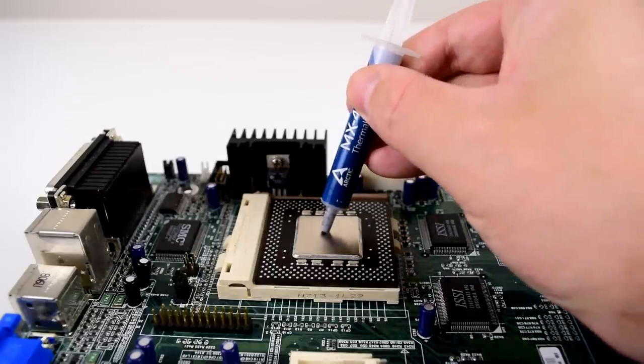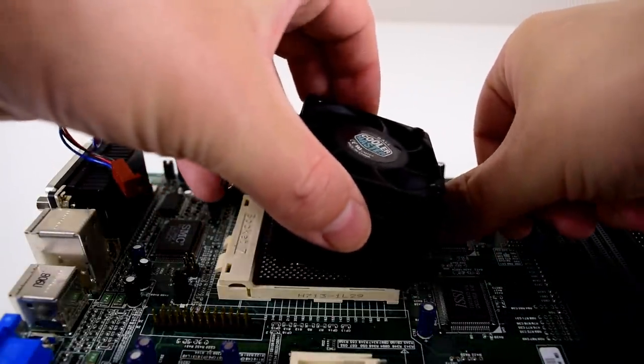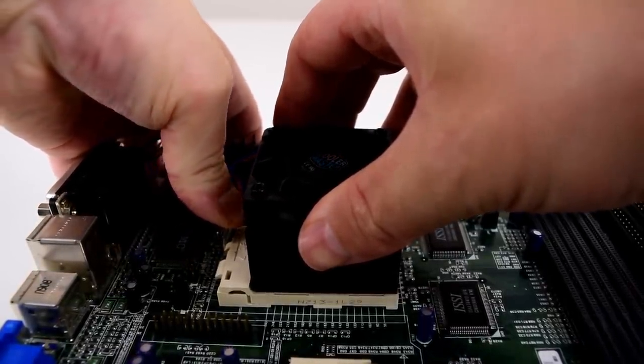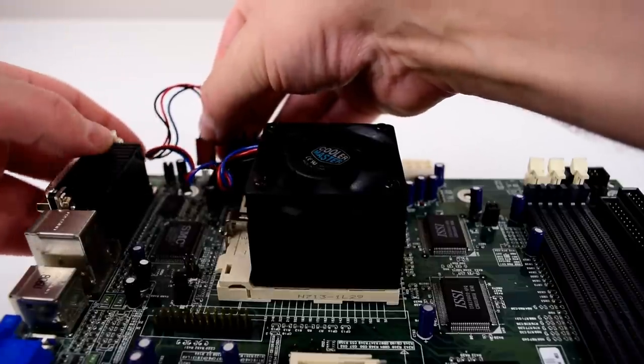It's well known, and I've covered this in quite a few videos, that by turning off CPU and motherboard caches, we can slow down Socket 7 processors to make them compatible with older speed-sensitive DOS games like Wing Commander or Test Drive 3. This works great, but the level of control we're getting is quite limited.